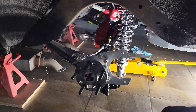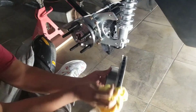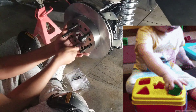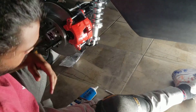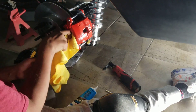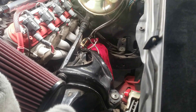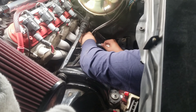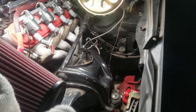You could probably get away with a little bit longer line. There are some 90-degree banjo fittings around here. I originally bought 90s which were too tight — I could have made them work but I would have had to grind out a piece of the brake housing. So these are 45s from Earl's, stainless, and they'll basically bolt up there. This side will go here, and this little housing has clips just like the other one, but instead of being bolted on it's welded to the housing.